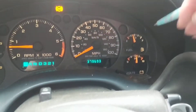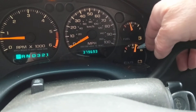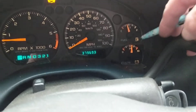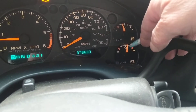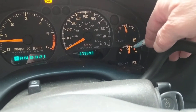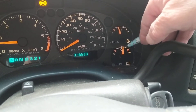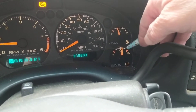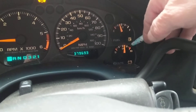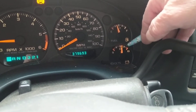This is the voltage gauge over here — it tells you the voltage of the battery and also the alternator. On a cold cold start like today, it'll be around 14.7 or 14.8 volts. The reason being there's a temperature compensation circuit that detects it's below freezing and will increase the voltage. As you warm up the car, the voltage will go down to probably 14.3 or 14.2 — anything in that region is acceptable.